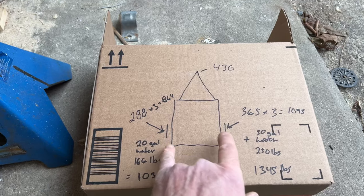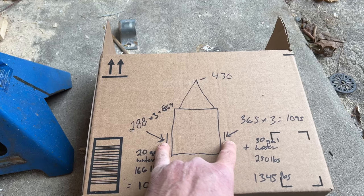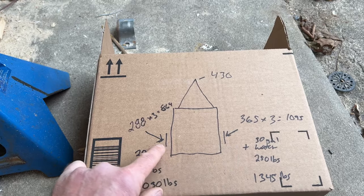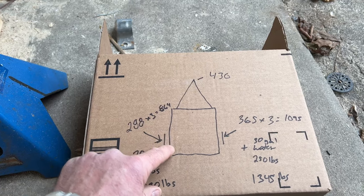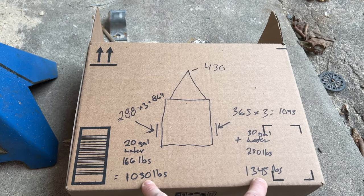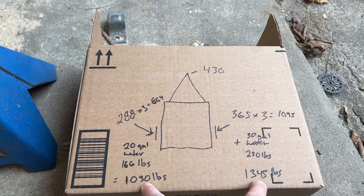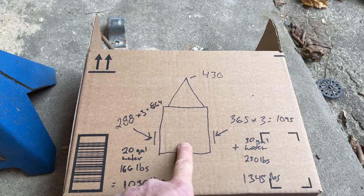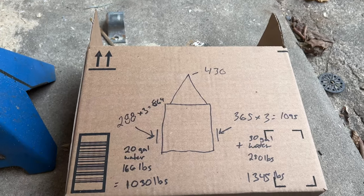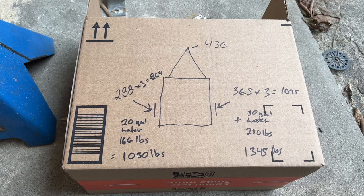I'm going to get a longer, wider axle for my wider tires. The axle is ready, and I'm thinking about putting in new springs. With this weight, I think I could go with 1,500-pound springs on each side rather than the 1,750-pound springs that the normal 3,500-pound axle comes with. I'll try to get the longest springs possible, which unfortunately means re-welding my mounts.